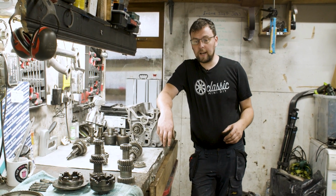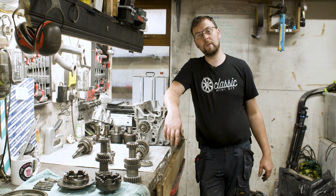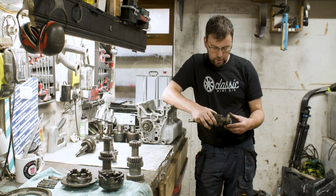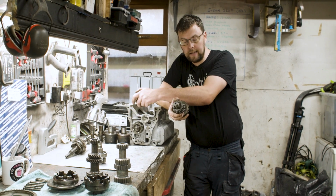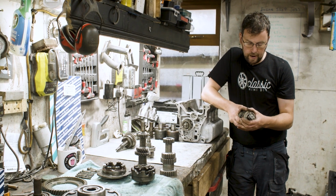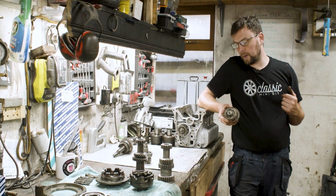If that happens on a race car, that little crunch is just the whole gear kit demolishing itself. That's generally what it is, as opposed to just that little crunch that you might get on a road car. So in a dog engagement gear kit, the chances of missing that, first of all, are massively reduced because you only actually have 4 dog teeth as opposed to maybe 36 or 38. And secondly, the spaces are much greater between the two. So the chances of actually balking the 2 gears like that are very slim. What that then means is that you tend to be able to get much more powerful down changes, and it tends to be much more positive.